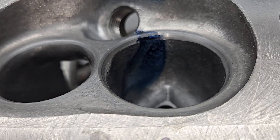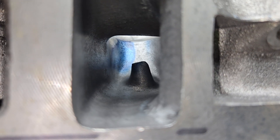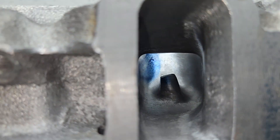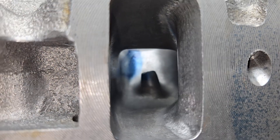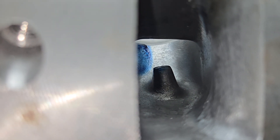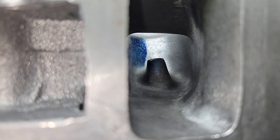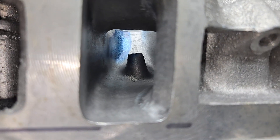Let's see what the bowl looks like — pretty much the same thing we had last time. Looks pretty good. You can just see a slight bit of blue on the right side of the guide. Going down the aisle — I really don't see any blue through the camera on number three. I really don't see anything on the right side of the guide.